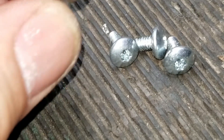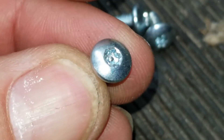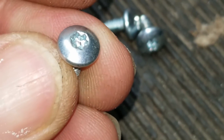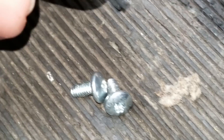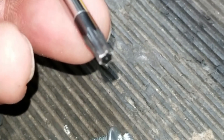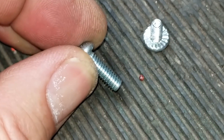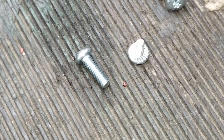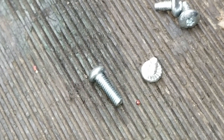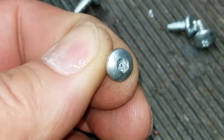To get this unit apart, you're going to need a T15 with the tamper-proof center pin. The pin on these is recessed enough that you could probably use a standard T15, just as long as it was pretty flat all the way to the tip where the lobes start. To reassemble it, the thread pitch and size is extremely close to an 8-32, so you can reassemble it with 8-32s. I don't have to go through the hassle of finding a T15 tamper-proof — I know they have these tools at Harbor Freight, but I just don't have them with me at the moment.